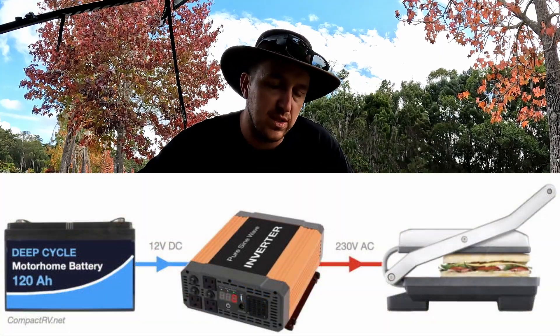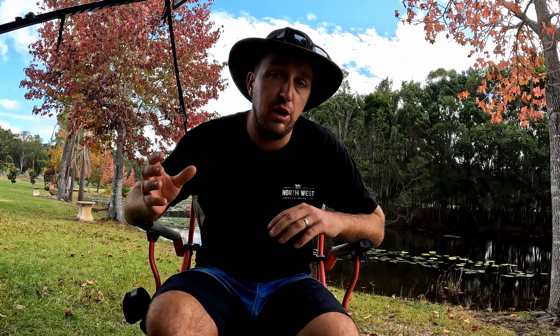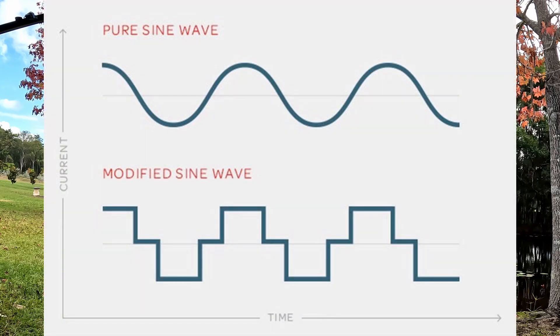But you'll find that the power points on the walls, your air con, and your microwave — stuff like that — will not run on 12 volts. They typically need a 240 volt AC connection, which you'll get by running a lead out from the caravan to a power source. A lot of people apparently don't know that, so they come away wondering why their microwave doesn't work. The way around that is you actually need a device called an inverter. What the inverter does is convert the 12 volts DC voltage to a 240 volt AC supply.